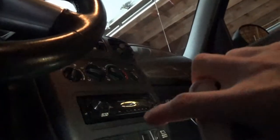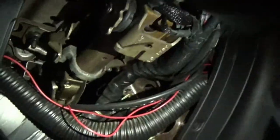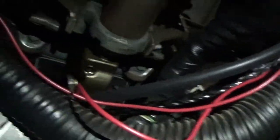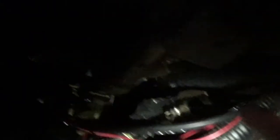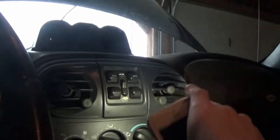In case you haven't seen the video where I wired up the other gauges, my wires are primarily under this shroud, everything runs behind there, and I have a ground back there. One wire is an RCA wire for my sub in the trunk, that tube is for the boost gauge, and two wires there - one goes for power with a fuse adapter in the fuse box, the other goes out for the AFR which doesn't do anything yet. I ran the wire down from the gauge and capped and labeled it, but I thought I ran it in here and I didn't - so I have to pull this little dash piece out.